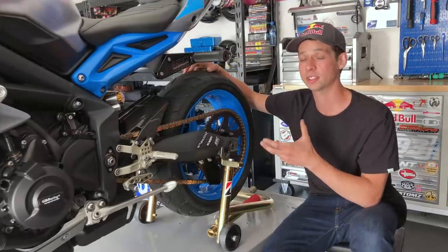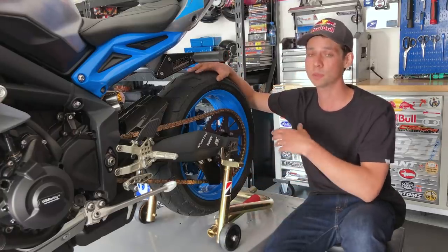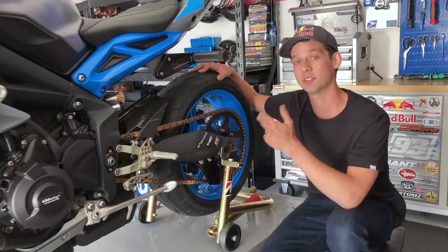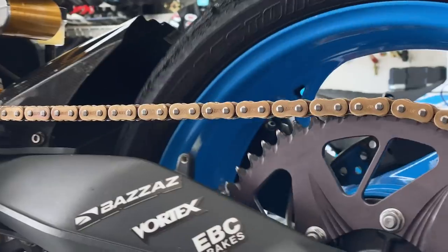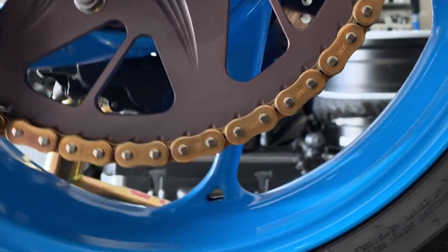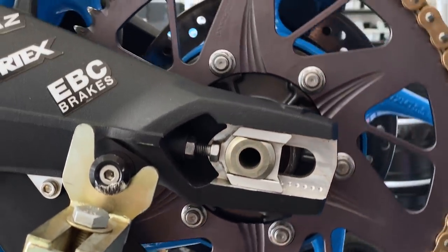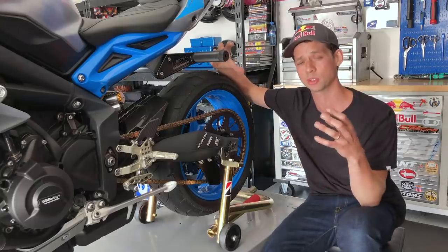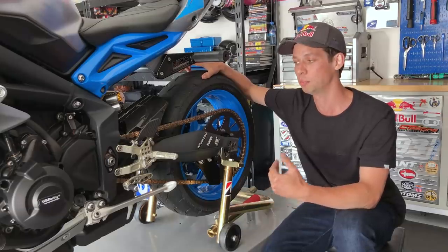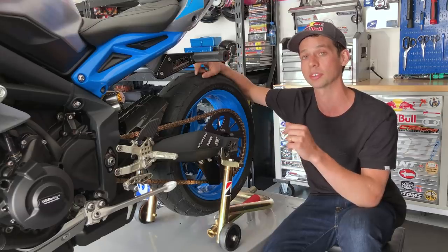So gearing preference is something that can change a bit from rider to rider, but I personally like something in the middle. This motorcycle comes with a 16/47, and I like a 15/56. Now, although that sounds big, that's almost 10 teeth shy of what some other riders may prefer for an ultimate torque on the first gear. I prefer something in the middle so I can still get a good amount of range out of first and second gear for some of the smaller platform demos, and still carry a high top speed if I need to. But overall, what I've achieved is a massive amount of low end torque for technical wheelie maneuvers.